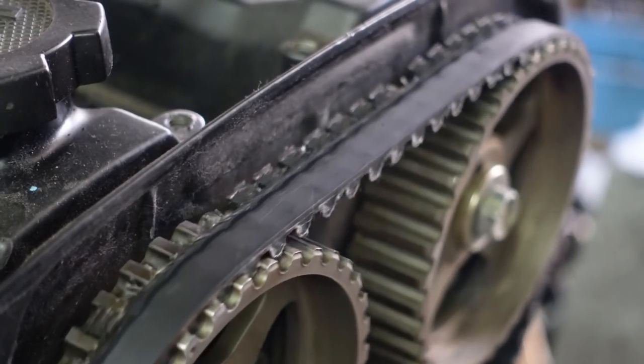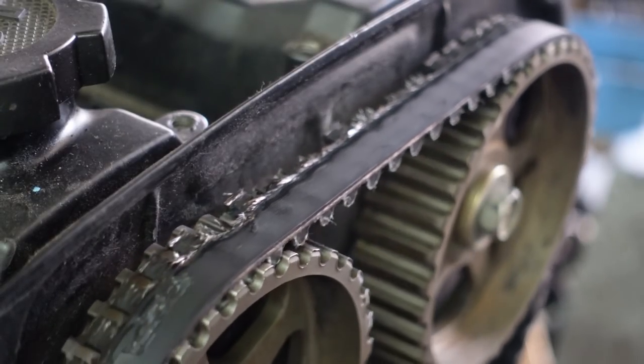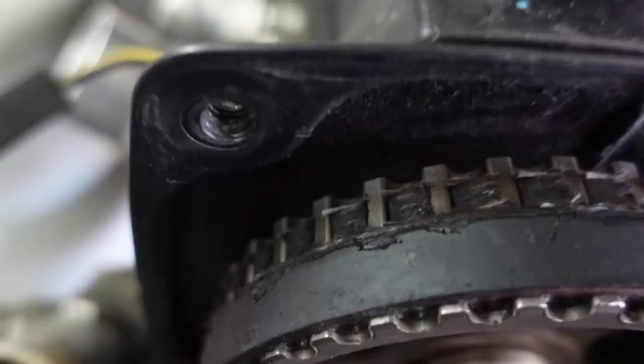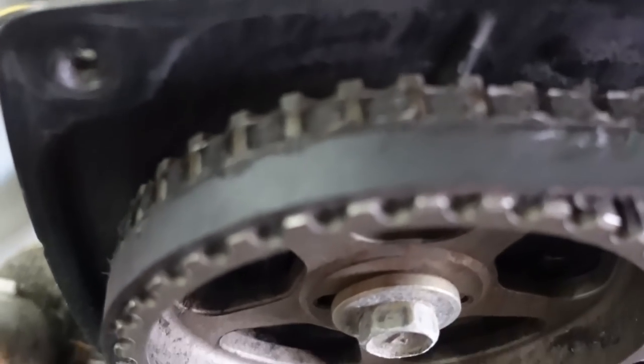So that's the bike carb engine. I did want to do a final goodbye driving video, but I couldn't because my timing belt looks really bad. This happened because one of the small bolts that holds the timing cover backing plate on the 4AGE engine loosened itself, fell down to the bottom of the timing cover, got embedded in there, and slowly ground away my timing belt. I drove a lot with a belt like that — wide open throttle, anything — and it didn't snap. So I am a very lucky person.